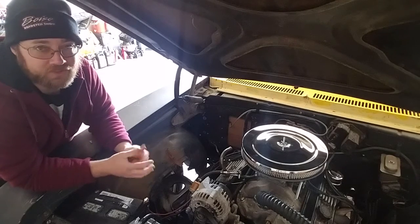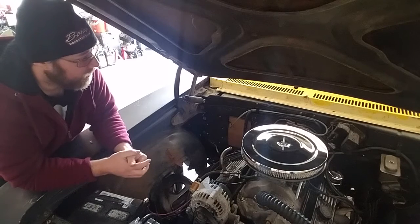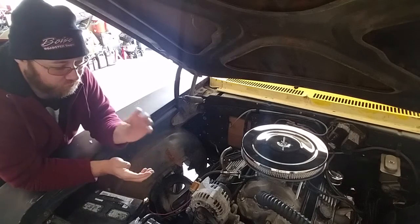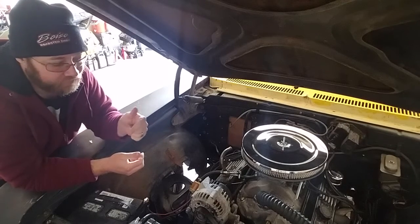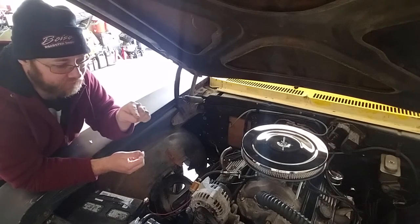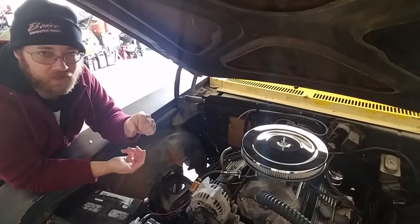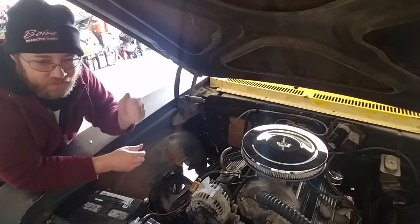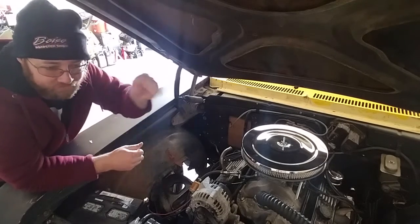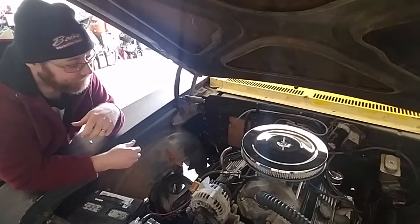And a little bit of dirt and some stuff actually did come out of it, so I'm assuming that was my issue. There's just a hole in the side of the transmission, and I think it's a press fit thing. But it's just a little tube, and it comes out at like a 90. And it bends, and it's a couple inches long. It's not very big. So I just shanked a bunch of stuff in there and beat on it a little bit and got some stuff to fall out, a little bit of dirt and things.